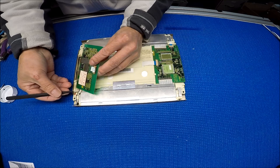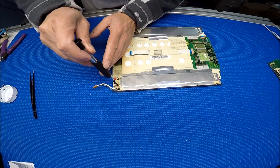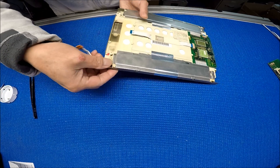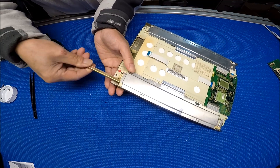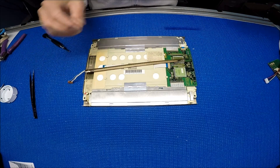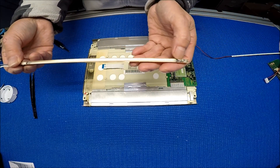Move the wires, flip over, grab the wire and disconnect. The lamp is here. There's one screw you need to remove. Here are the reflectors. We're going to mount the LED strip right back to the same reflectors on the right side. But first we have to remove this lamp.